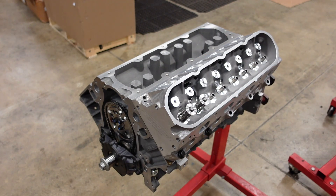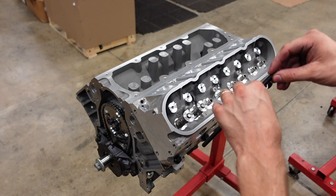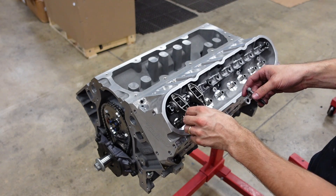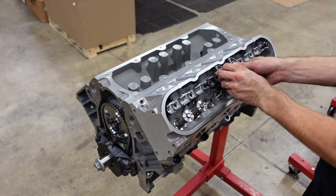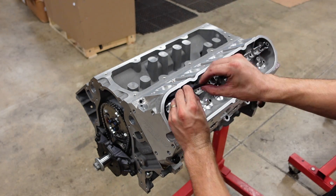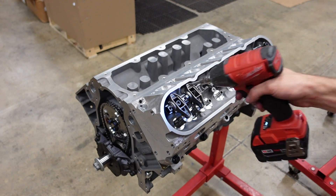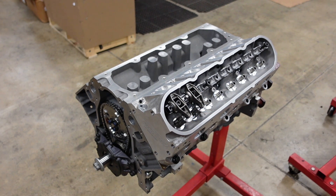First I need to make sure I'm on the correct rotation of the cam. I'm going to start at a dimension that I think is going to be pretty much there. At the moment my pushrod is way too short, so I'm going to go ahead and make it a little bit longer. The checker pushrod is currently at 7.58. I know these Johnsons like to run at .035, so now we know what length pushrod I need.